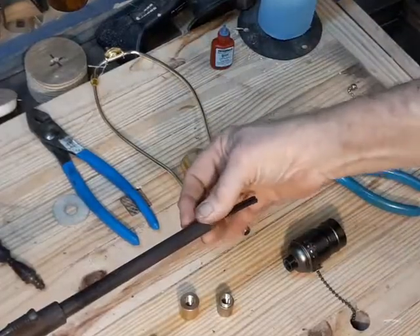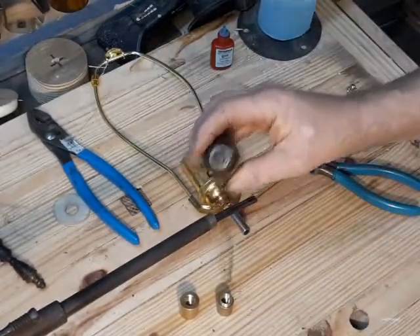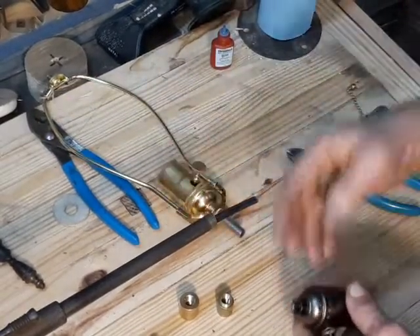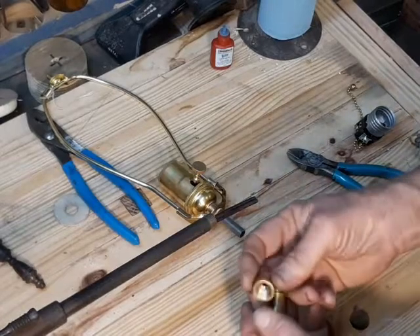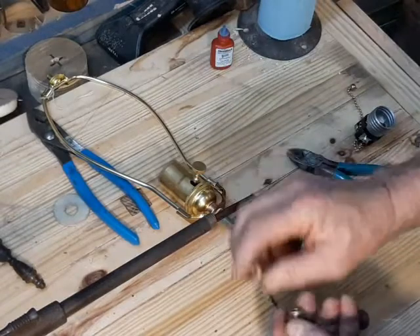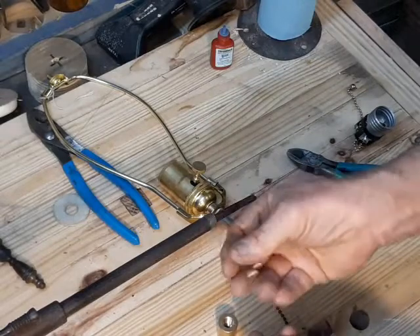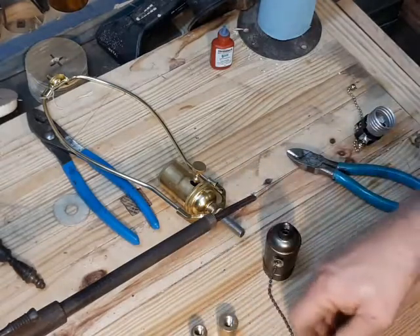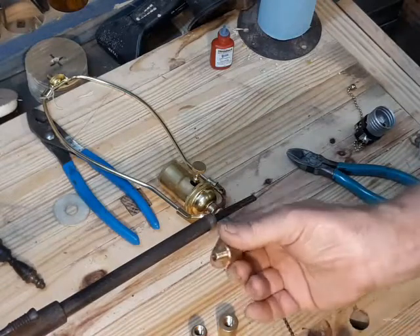The pipe we have here in the lamp is what's called quarter-inch lamp pipe, and the socket we're going to be using takes what's called eighth-inch lamp pipe. There are a variety of ways to adapt quarter-inch to eighth-inch. These various little fittings: that one has big threads here and small threads on that end; this one has big threads all the way through but has a little sleeve bushing that screws in — probably the most compact of them all; and then this one has big threads here and a little nipple sticking out the top.